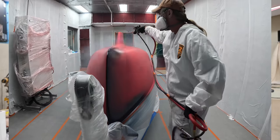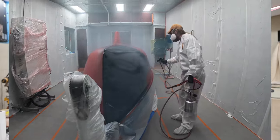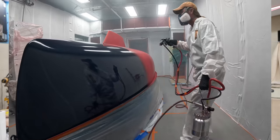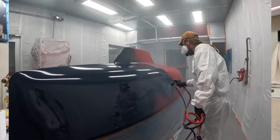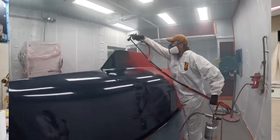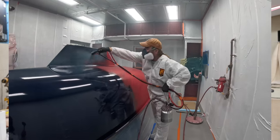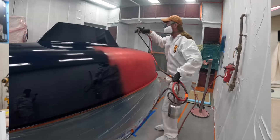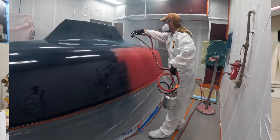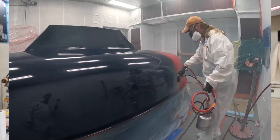This is something that I was really surprised with. Typically when you're spraying you're not going to get full coverage on coat number one — coat two, sure, that's pretty much expected — but I've never had full coverage on one coat. Looking at this boat, it's a bright red boat and I'm going over it with a dark blue. I've got full hide on coat number one. That's never happened. Taking a really critical look at it, it's not blotchy — it is full coverage.